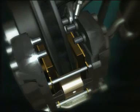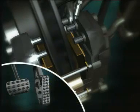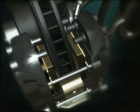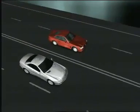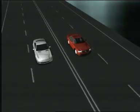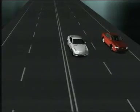For SBC, the emergency situation is confirmed if the driver then suddenly operates the pedal. The brake assist is directly enabled and maximum braking efficiency attained. On the other hand, if the driver slowly operates the pedal, normal braking occurs. The higher dynamics also make SBC with ESP or ASR clearly superior to all other current systems. Fast, finely metered brake pulses allow a breakaway vehicle to be stabilized early and safely.